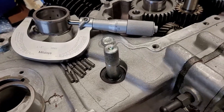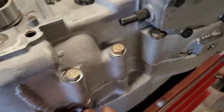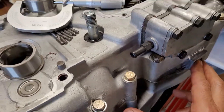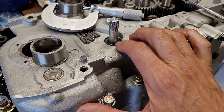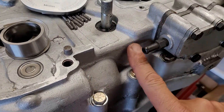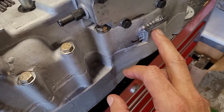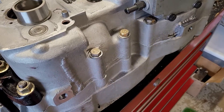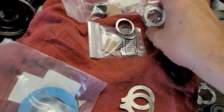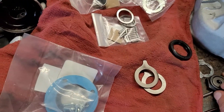One other funny thing about this bike — this is the one that had the oil leak down here. I had to mill that, then drill and tap it, then weld this piece on here because they had filled these holes. What I think happened was it was actually missing this seal — the shift shaft seal — and gear lube was coming down, running onto the gear case. I think they thought it was leaking out of one of these holes and eliminated both of them.